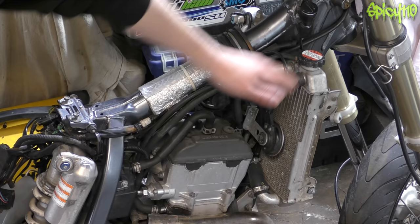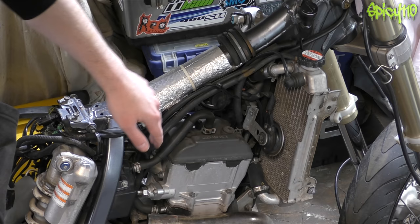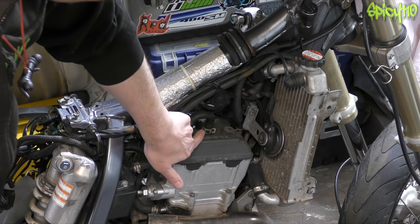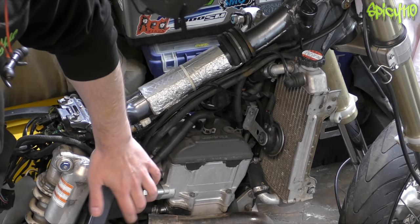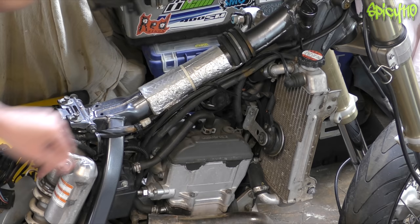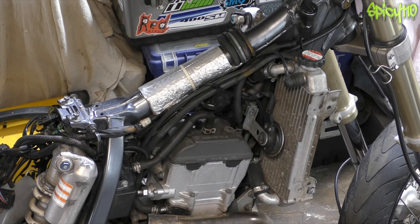When you first look at all this wiring you're like, oh my god, what is it all? But when you actually pay attention to what goes where you're like, okay that makes sense - that's the electronics, you've got the throttle cable coming down here and then the breather coming off the top. Just to make my life easier I'm going to put little pieces of tape around each one and label them, like 'top of engine', and leave that attached to the catch can. I'll take a few more pictures - I just don't want to be in a position where I route something wrong and have to take half the bike apart. I'll label things up, take them off, put them in the box, and see what's the next obvious thing until we have less and less here.